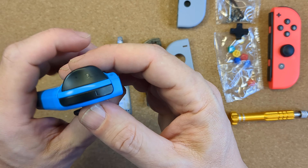I felt bad for anyone buying this kit and attempting to fit the shells relying on the included tools — it could end up with parts being damaged, and it's a real knock to the confidence especially if you're new to modding. Fortunately I've got the right tools: I use my Xiaomi WowStick electric screwdriver for quick disassembly, with the red screwdrivers for carefully putting screws into fresh holes, cutting new threads and avoiding over-tightening. As well as screwdrivers I'd recommend a separator tool, a spudger to help with ribbon clamps and battery connectors, and a good pair of tweezers.